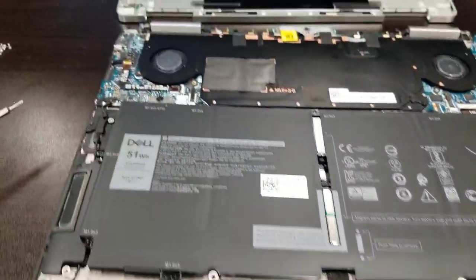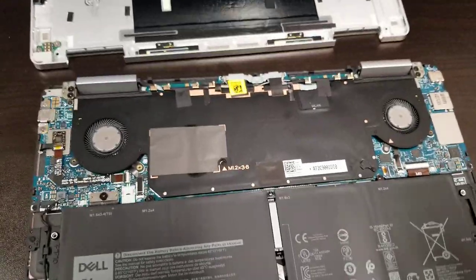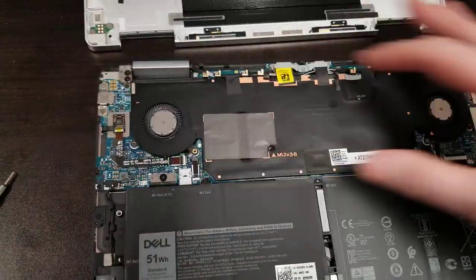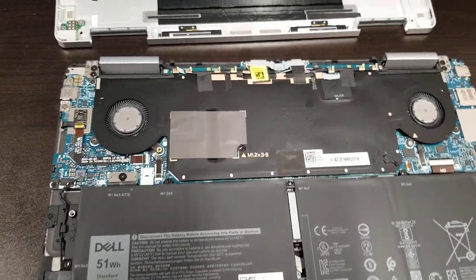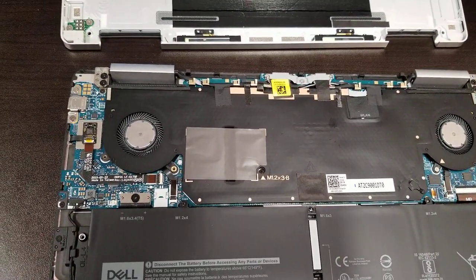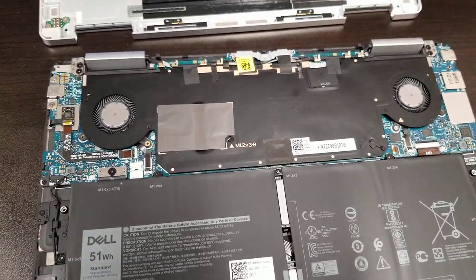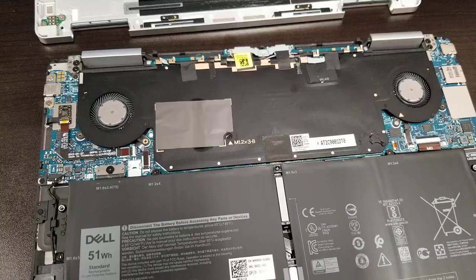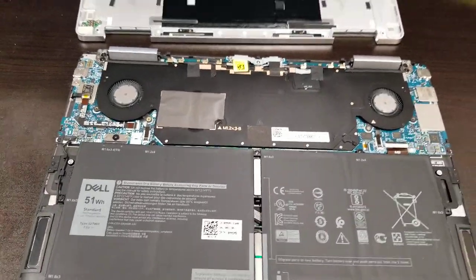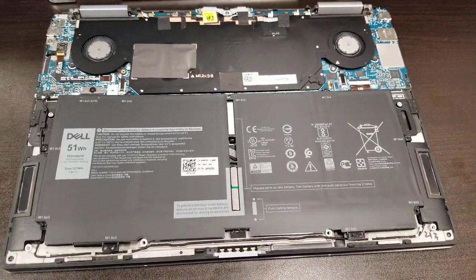The only problem is, when I say they learned from Apple, there is no hard drive, there is no memory. It's all on board. So the motherboard is basically a unified hard drive, memory, processor, all in one unit. This presents a problem for recovery of data. I mean, this is a 500 gigabyte hard drive. If you store your files on here and you do not have cloud backup, you are basically screwed.